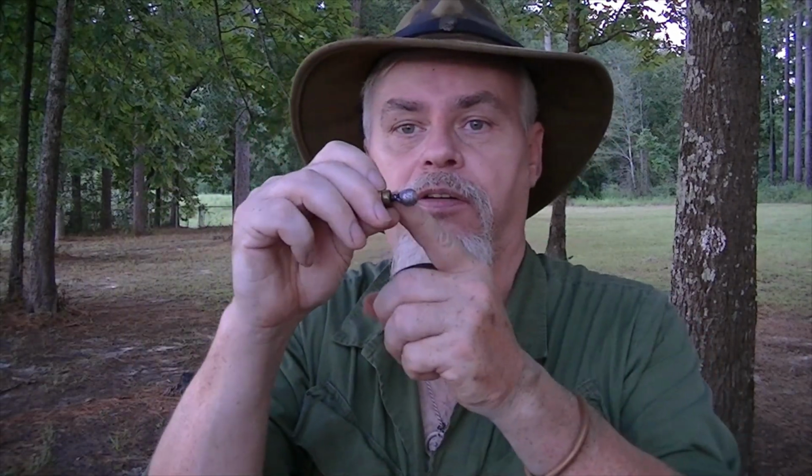Screw it down until this collar right here is up against the ball and stop. Now pull like I did. Blackie, I can't pull it that way. That's the way you got to pull it. I have anchored this into a vise before, put a wooden block across the rest of the face and went tap tap sideways and got it to come off. It's how tight is that ball in there. Now you saw me pull it by hand. It was effort to do this. But this is how I would have had to do it in the field right there.